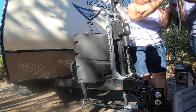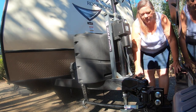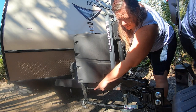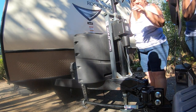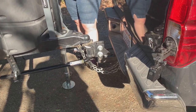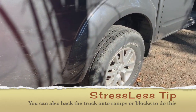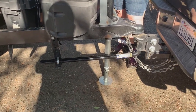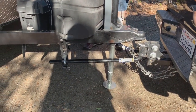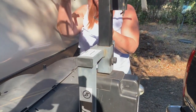You've got your latch pinned in during your trip because you don't want this coming loose — that would be a bad thing. So we keep this locked and then we're gonna need to take the stabilizer bars off. We have to lift the trailer high enough that those bars are no longer stuck to their brackets. The bar is held in with a bracket with a kind of an L-shaped pin held in by a cotter pin. Pull the pin.